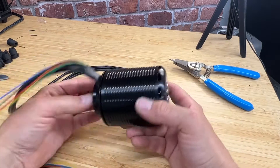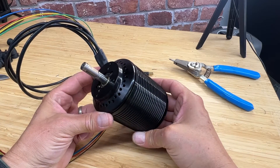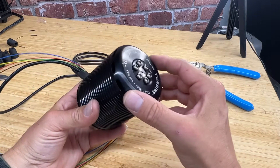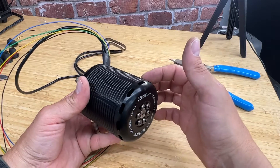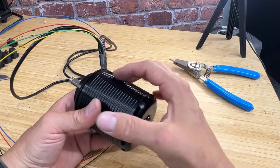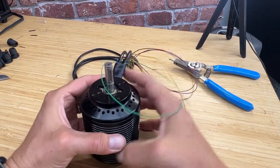One thing I want to mention about the bell, or the end rotor here, is that it's all one piece. Everything that's black here is 7075 aluminum, which is comparable in strength to a mid-grade steel, so this is an extremely strong rotor. Many of the existing motors for e-skate are two piece — they have the cylindrical part and then the cap, which is pressed on. Since this is one piece, it's much more rigid and stronger. The reason they make it in two parts is because it's cheaper; this has to be lathed from a single block of 7075 aluminum, which takes time and costs a lot of money.